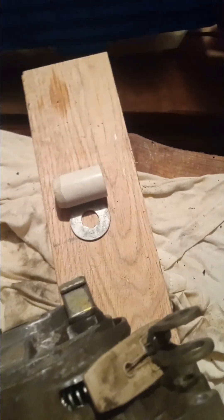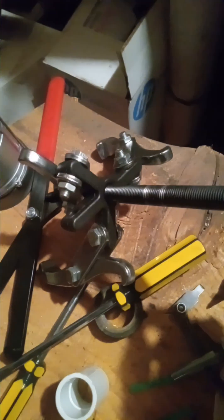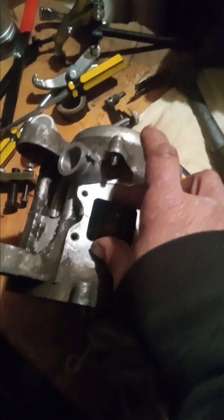I just wanted to show the oil seal press — if you can't find 46-year-old Honda special tools, you make them yourself. I also used this jaw puller as a case puller and as a puller for the magneto and stator. I used it in bipolar configuration for the stator and tripolar for the case. I'm just hoping I didn't damage anything since it was a little snug.